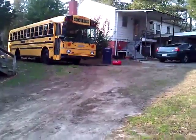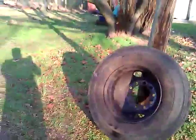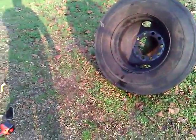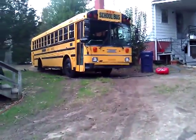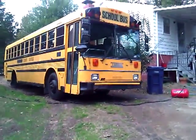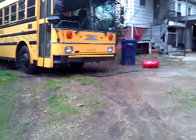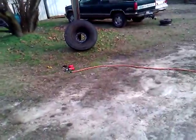The eight and a quarter rims look better anyway — they give the tires a better stance. A narrow rim squeezes the tires too tight and bows them out a little bit. That's also why it was leaning a little bit, because it had two different width rims on. It's jacked up on the back, but it's more level now than it was, so that looks a lot better.